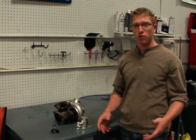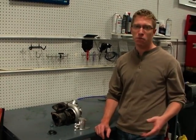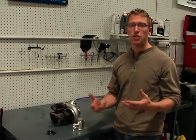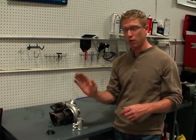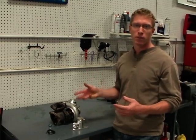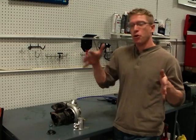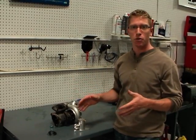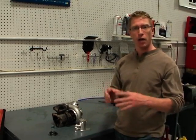One of the last pieces to a turbocharger is the blow-off valve, compressor bypass valve, or diverter valve. While there are three different names, they all effectively do the same thing: they vent off or release back pressure that's created from being in boost with your foot on the throttle and then suddenly closing the throttle. The turbine impellers are spinning at 80 to 100,000 RPM. Suddenly we close the throttle and create a blockage, so all this back pressure builds up. If we don't release that pressure, it can side-load the bearings in the turbo and wear them out prematurely.